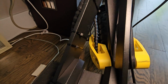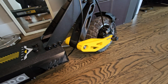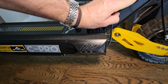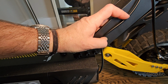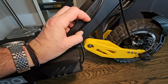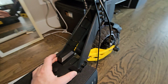And here we have front suspension. We have this big bolt, so you can adjust that. The only thing I don't like here, and it's poorly made, you can hear how it's catching the cable, and this is so easy to fix. Just push it back here. It's not going to catch, and get one of those cable management ties, make a hole here and just zip tie it, or make something nice, that double-sided tape holding right here will be so much better. This cable from the brake, it's fine, and look here on the side, they put zip ties. Such a nice construction here, so nicely done and looks so beautiful, and they just zip tie it.